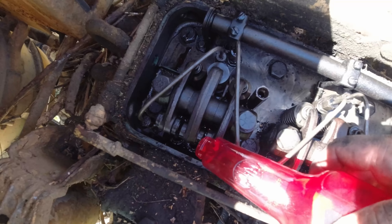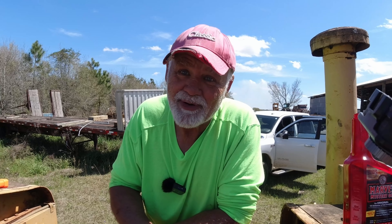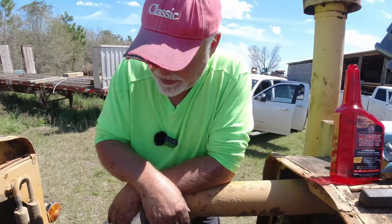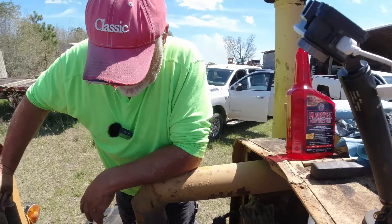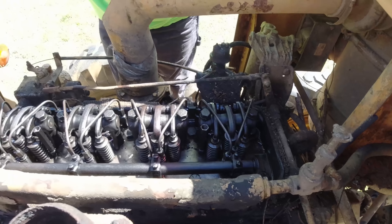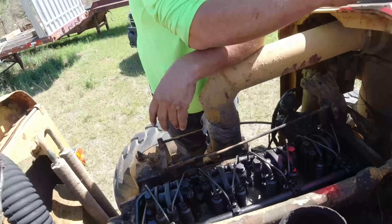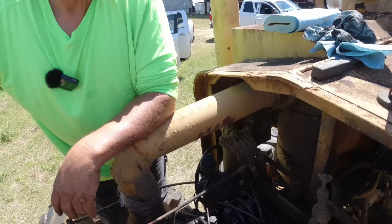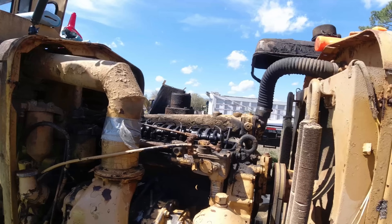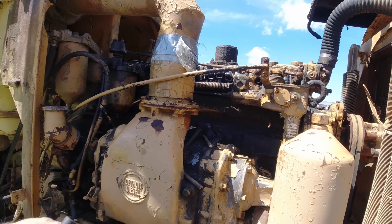Is that working? It's going right in. Now, I know a lot of people are seeing trash in there, but what we do before we spin it over — we'll bring a vacuum and try to clean that out best we can. Because I know we got dirt in there and I couldn't help it. I think we just need to let that sit. We can move it around a little bit since we're here and try to let it work through. I think we got on top of all four pistons with that — we used the whole bottle. That's 32 ounces of Marvel Mystery Oil.